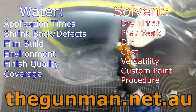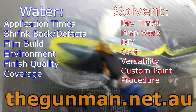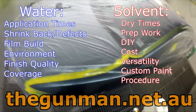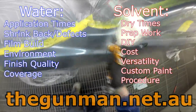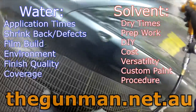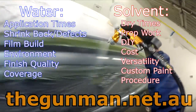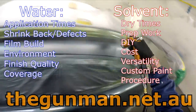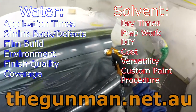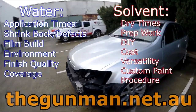You may also say that, well, you know what, environment, give that 2 points, because environment is extremely important, especially when used on a commercial basis like what we do. And at the end of the day, the customer does end up paying for the paint bill because they are the ones that pay for their insurance, who then pay us to do the job. So you may be able to scrub cost off, and then for you, water will win. There are certain shops that I would definitely say you're best off using water in, and certain other shops I might say, maybe go for solvent.